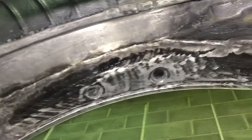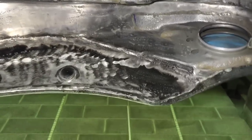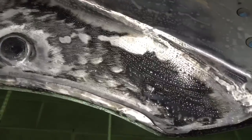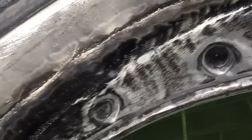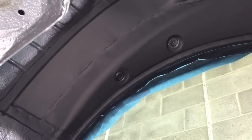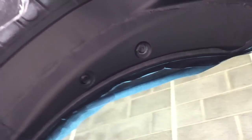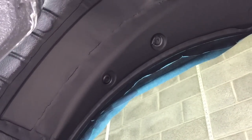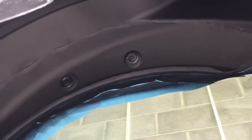Right-hand side repairs are fully done now. New inner arch panel welded, cleaned, and just going through the metal prep process, which is why it's wet. We'll wash that off before applying the POR-15 rust-preventative paint. We've now used the POR-15 rust-preventative paint — two coats of this — to thoroughly coat all the bare metal and all the seams, and fill any joins where the two panels lip around on the U-section. Then that's been scotch-brited down, and this is the high-build primer now, which is like a matte black finish. Once that's dry, that's scotch-brited down.